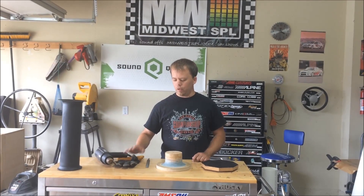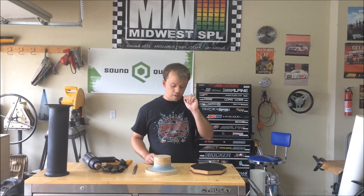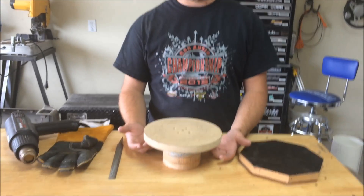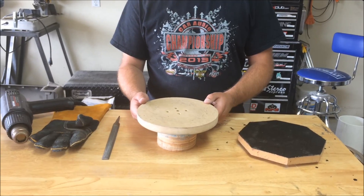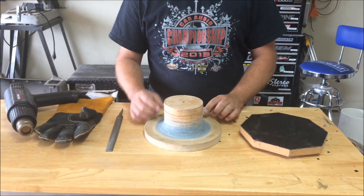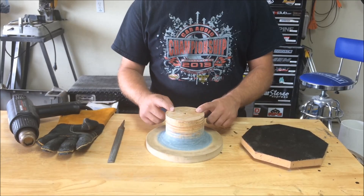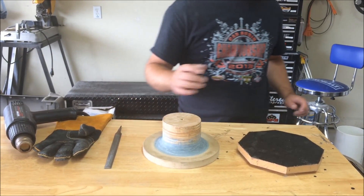So I made a mold right here, and then I used a heat gun, a welding glove, and a file — I'll show you why you need all these things. To make this mold, I cut a base with my Jasper jig, that's about an eight and a half or nine inch circle, and then I cut four pieces of birch with my Jasper jig again, but these are the exact size of the pipe that I'm wanting to flare.